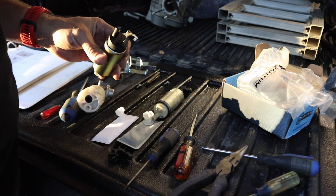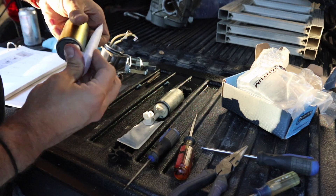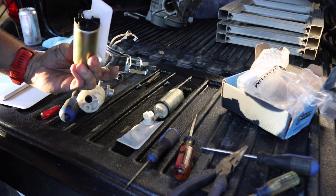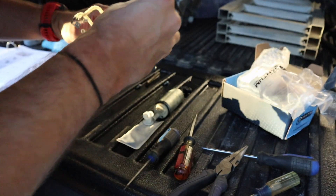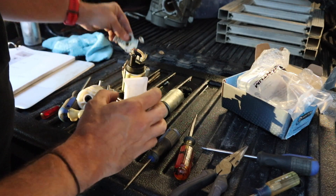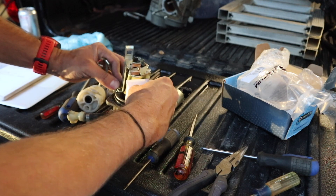With the top housing snapped together, go ahead and pull the little cover off of the new fuel pump. Take the other filter — you can see there's an opening here, one there, and a little tab that's going to fit — press that on snugly. Then take the new rubber piece and get that lined up so it sits together just like that. Next, take this assembly and set it down in, making sure it's seated properly. Now get the cage back on: the small piece goes over first — it really only goes on one way — and then the larger piece sits over top of it.